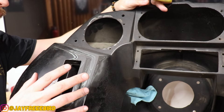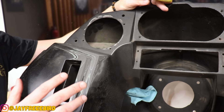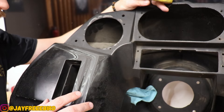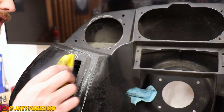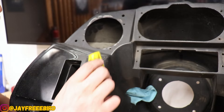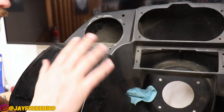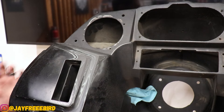I thought it was going to be more of a challenge trying to get this to blend, but this ABS plastic is really workable. When it comes to sanding and making sure you still have that original curve on these plastics, you want to make sure it still looks factory after it's shot with paint. When you're sanding, you want to go in a cross-hatching pattern the best you can. In some areas I just can't do that all the way, but that's why I was doing that motion — trying to keep a nice hatch pattern across the plastic. Let's get to the sides and get these done.